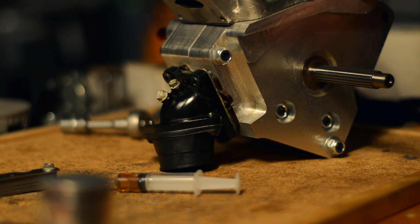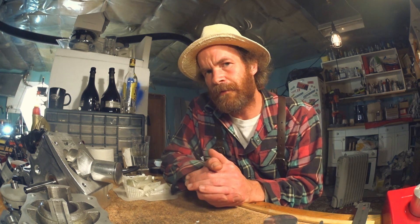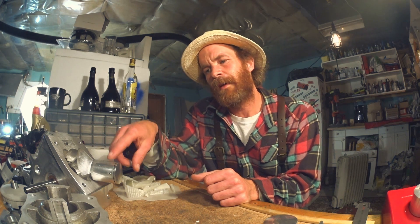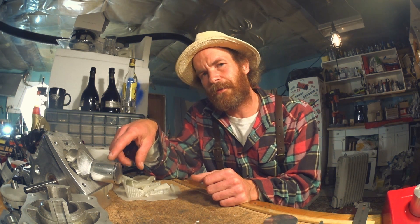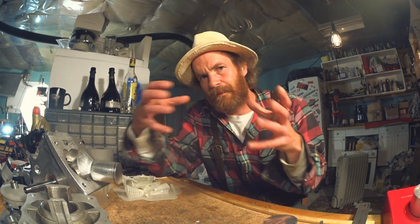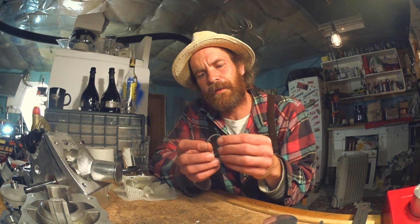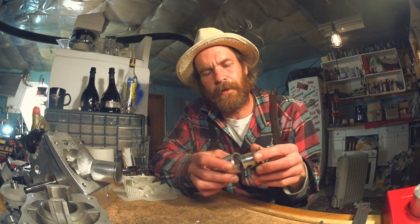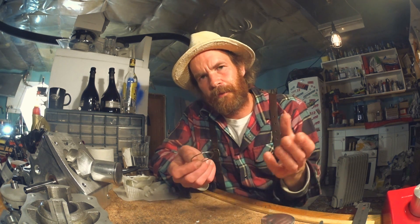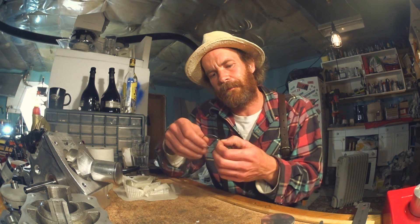Someone also commented that I should rewatch my Bonneville video. After a lot of head scratching we found out that our troubles with cutting out at higher RPM was an intermittent stuck ring thing — the ring would stick and then come loose again. I'm thinking somehow this ring doesn't seal like it should, and I think it's the excessive volume behind it. We'll do a test anyway with a proper ring gap and see if it makes a difference — could give us some pointers as to whether compression is our problem.